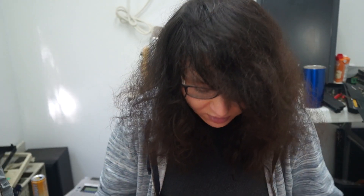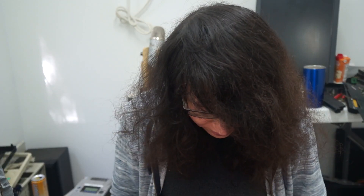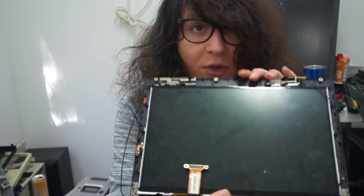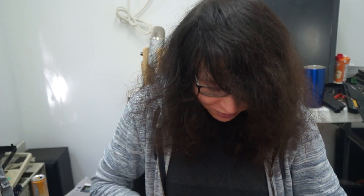The X200S is on the right and the Lenovo logo is on the left — that's an easy way to identify a 1440 by 900 panel in an eBay auction listing. I've actually gone through and rebuilt panels before due to minor things, like maybe a ThinkLight isn't working. This is my attempt to add WAN — I'm still working out some of the details, but I have seen it done with purchased WAN antennas. On this one, I'm just adding some antennas scrapped from another computer to give us WAN capability.